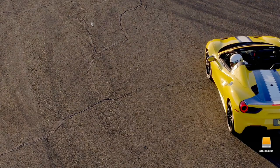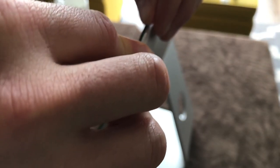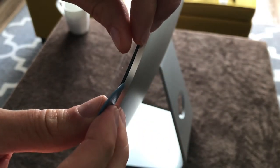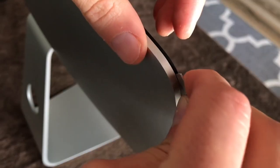I just want to apologize — I know this is a long video, but I really wanted to show you the full step-by-step process without skimming. Fast forward or rewind as needed. Clean work area — check. Now you're just going to slowly insert the blade between the aluminum casing and the screen and slowly push. You'll feel it — it's going to feel kind of soft — then use your guitar pick to help separate the monitor from the aluminum casing. Work your way around the corner slowly.